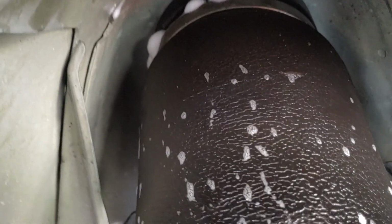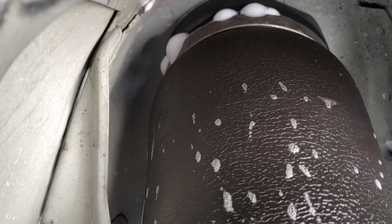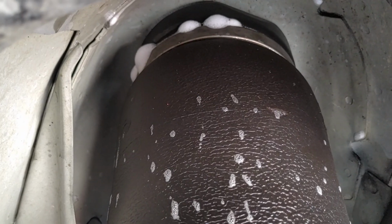Look up there. See that? I just cleaned all that up when I started the video, and there they are. It is leaking. So that's where my slow leak is coming from. So now I'm gonna have to replace this Arnott.